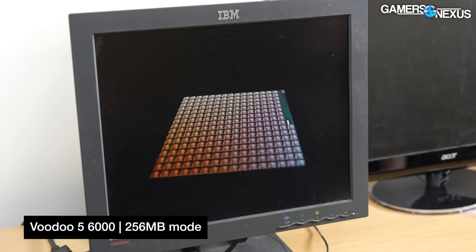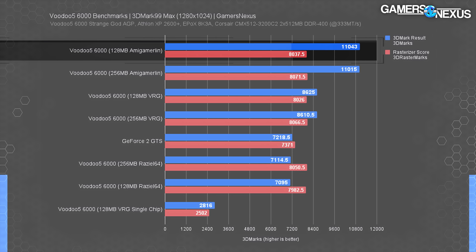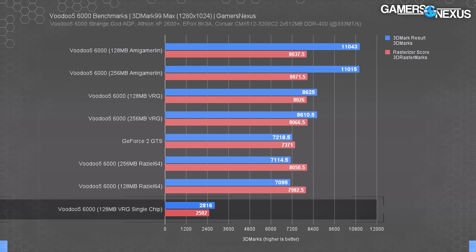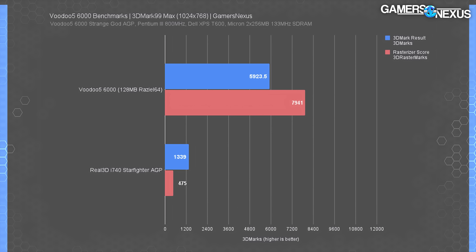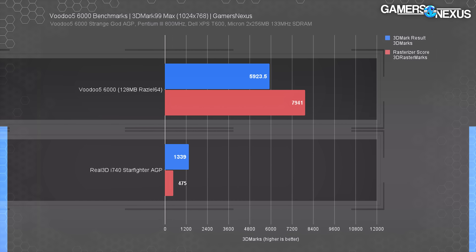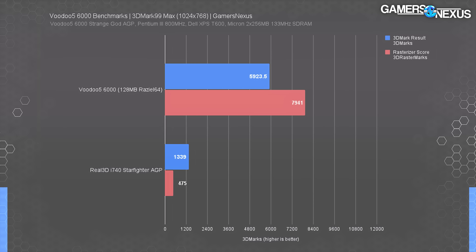The 32-megabyte texture test ran extremely poorly in 128-megabyte mode; in 256-megabyte mode, one edge of the texture consistently showed corruption, which may be a bad memory chip or a software issue. Amiga Merlin's 128-megabyte test scored 11,043 3DMarks — still 53% ahead of the GeForce 2 GTS. The GeForce 2's 7,219-point average in turn outperformed the single-chip Voodoo by 156% on the older Pentium III platform. At 1024×768 the CPU score is less than a third of what it is with the Athlon. The Voodoo still managed a 342% advantage over the i740's score at 5,924 points versus 1,339.